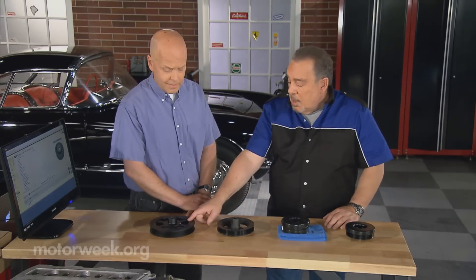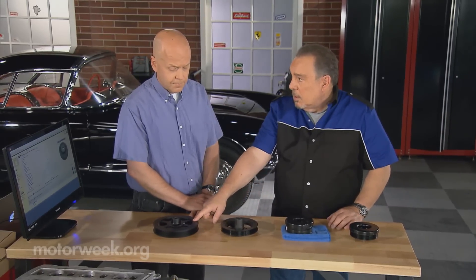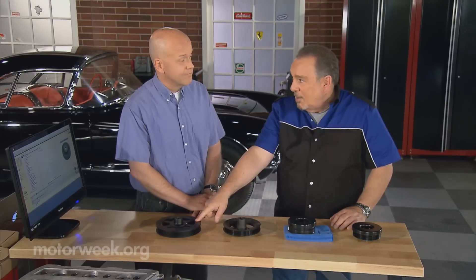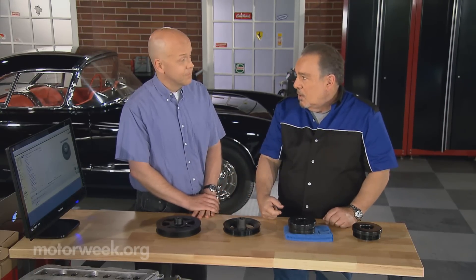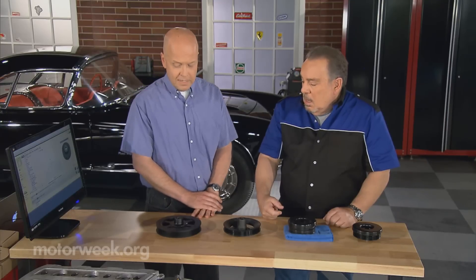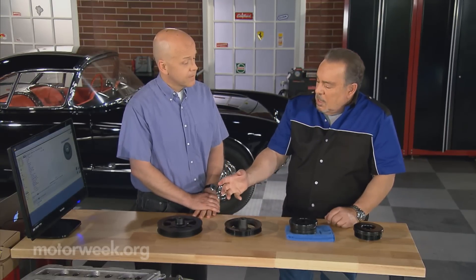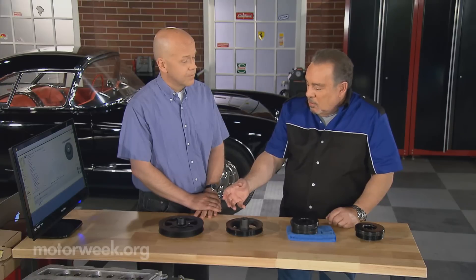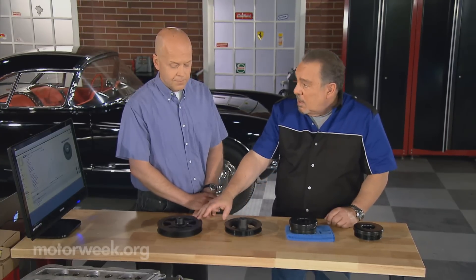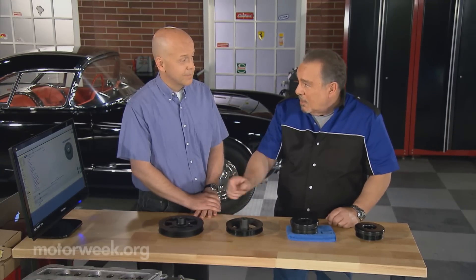What we see in the repair shop is oil leaks — oil gets on this, and rubber and oil are not compatible. So this swells up and everything comes apart and you get a horrific noise out of it. So as a driver, if you get this obnoxious noise under the hood and somebody condemns the engine, make sure that they have checked the balancer first.